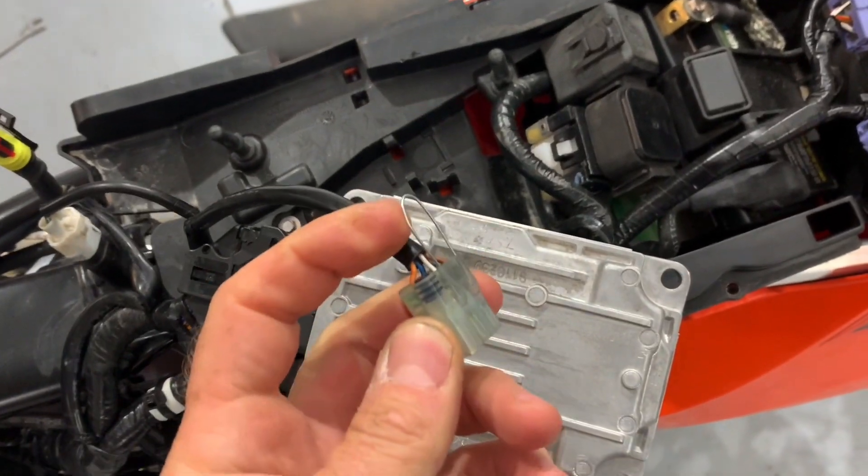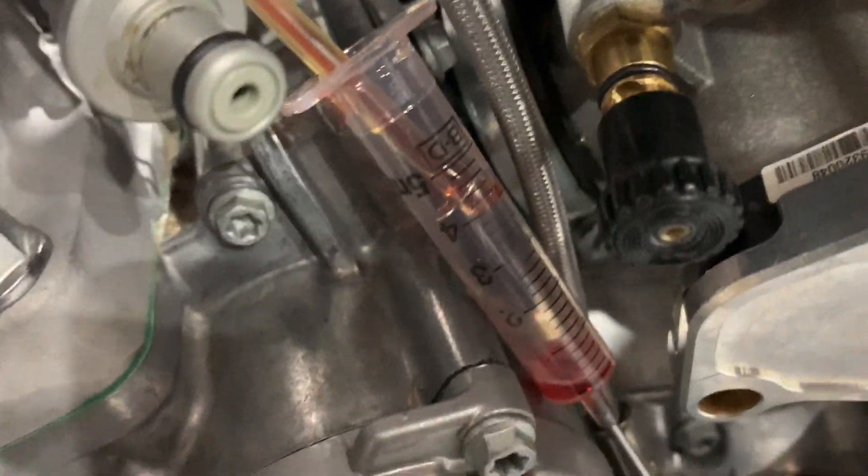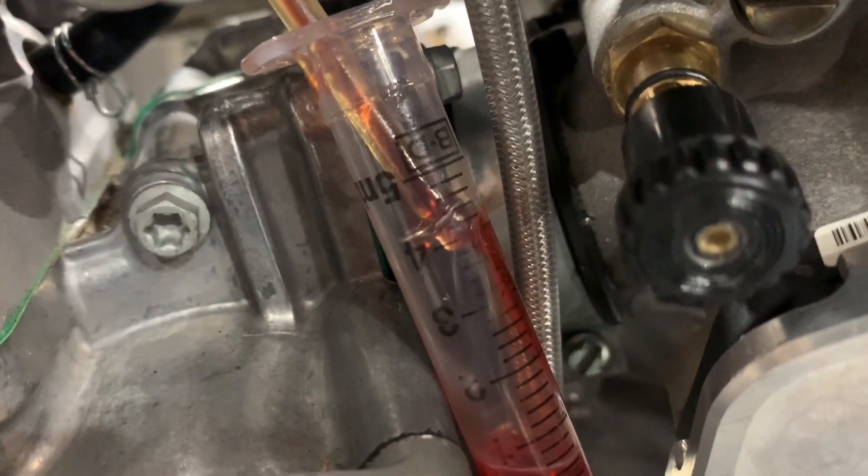And no, it hasn't. I'll try that again. I'm just going to remove this loop of wire — there we go, I've pulled the loop of wire back out. I'm going to start that process one more time: wide open throttle, I'm still holding wide open throttle, pressing in the loop of wire to bridge those connectors. Come down here and now I'll let the throttle go. There we go, that worked the second time. You can hear this one is clicking at a constant fast rate.